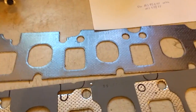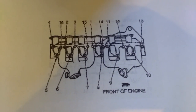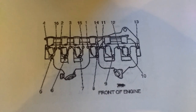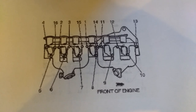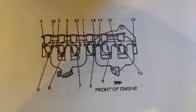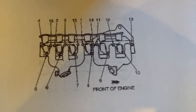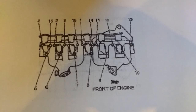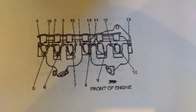The next most important thing is that you follow the torque sequence to a T. And another important thing: if you go to a junkyard to get some of this stuff, when you take it apart, do it in the exact opposite of the torque sequence. I typically give each one starting with 16 and working back a quarter turn loose, and then start the sequence all over again. I've had good luck with that.